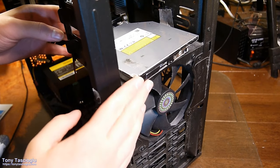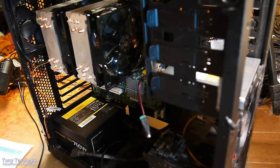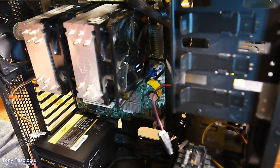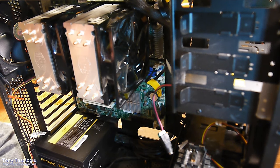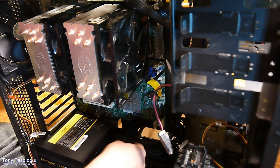The front panel's taken off for more airflow, so you know, just. I like to lodge it this way so that the DVD's turning, don't spin it too much. Right, that's our DC jack that I just put on the end of that. Now let's run power cables. We're going to need two of these. One for our hard drives. So this can go into any of the SATA/Molex connections, and then just feed the rest of the cable back.